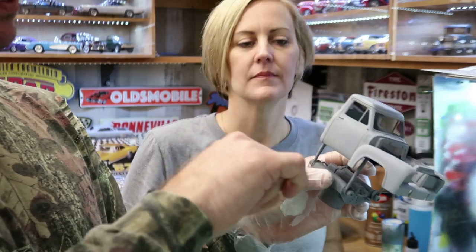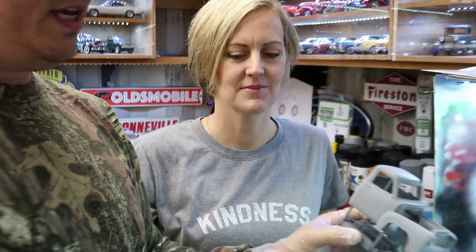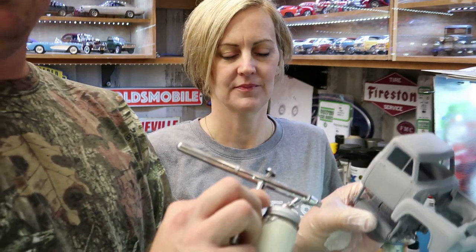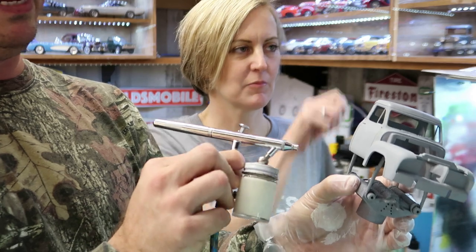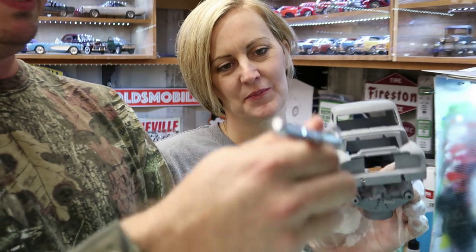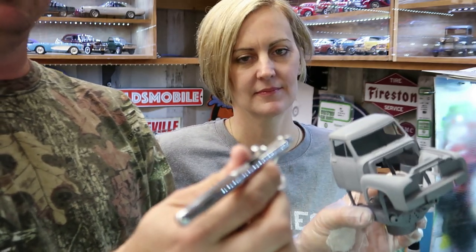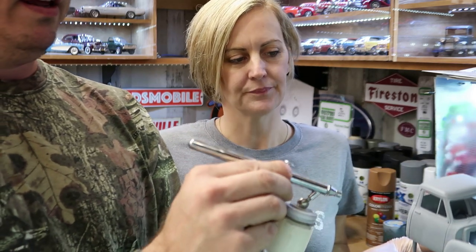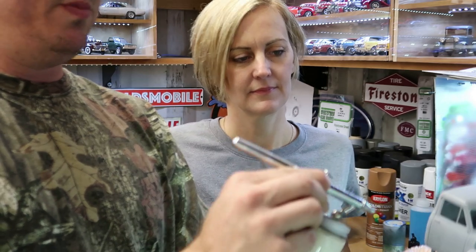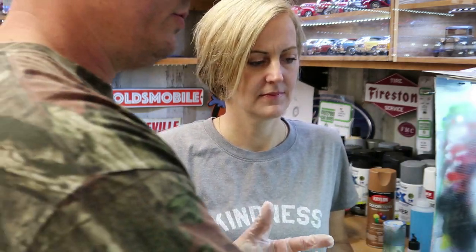the fender and you want to outline that seam first, you have to keep your airbrush at that angle as you go around, and the airbrush has to change, keep the angle, rather than trying to paint that angle. So her problem is she's trying to paint an angle, but she's trying to do it with the airbrush staying at the same angle. But if you could imagine if your airbrush was attached to that seam by a piece of string and you pulled out on it and it was attached to the tip of your airbrush, that would be the direction you'd want to go. It stays pointing to that surface area. Anyway, obviously, most of you guys know what I'm talking about. Heather's just learning.